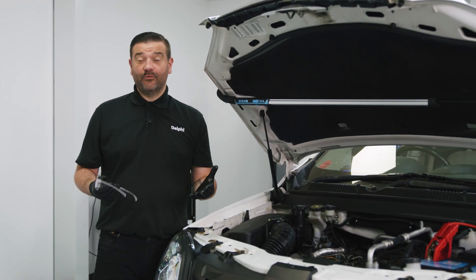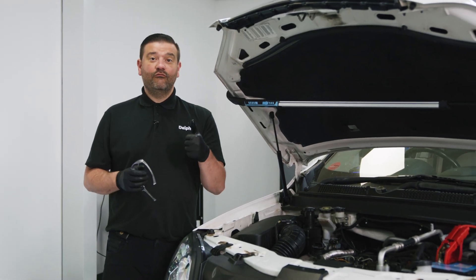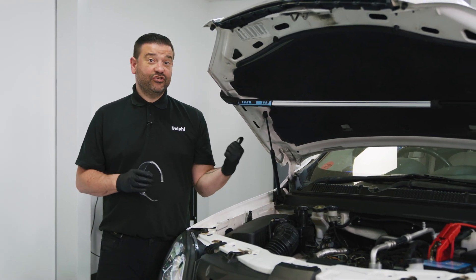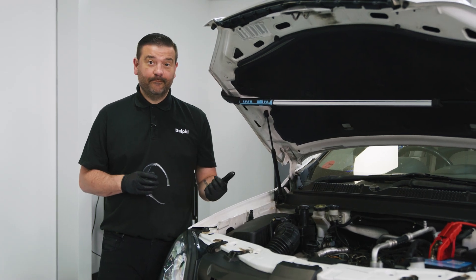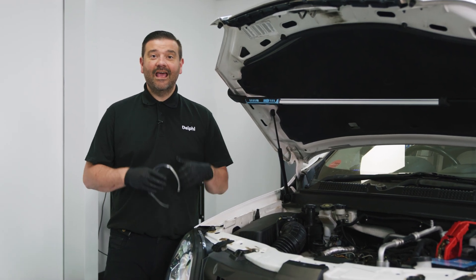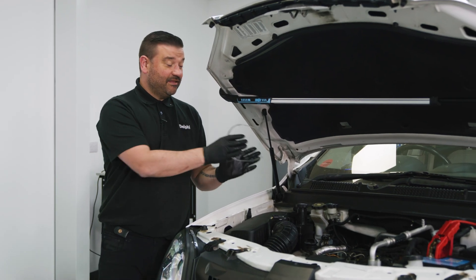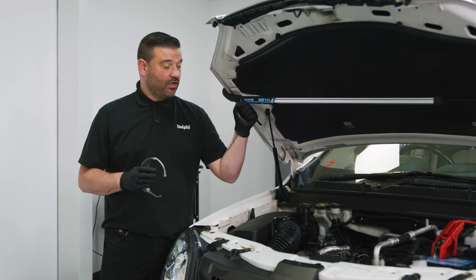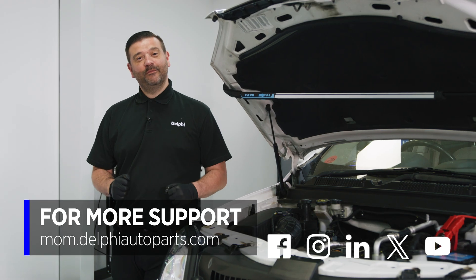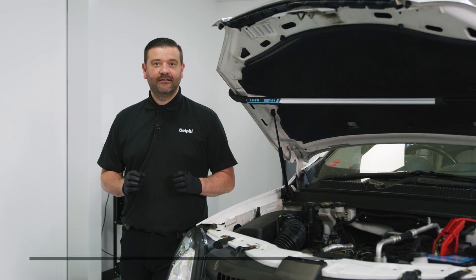As a quick summary: be clean, and don't remove the caps until you're fitting the injector into the cylinder head. For air bleeding - if you've got an in-tank pump, check for diagnostic routines to run the pump or a high pressure bleed routine. If you don't have an in-tank pump, use a manual pump to pull fuel through. If you don't have an HPV and can't use the HD3000, keep the injector high pressure inlet pipe slightly loose, bleed the air through, then lock and torque them up and start the engine. Thanks for watching - follow us on social media, visit the Masters of Motion online hub, or check out the Delphi Academy for more expert-led courses.